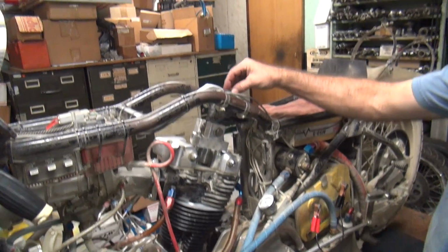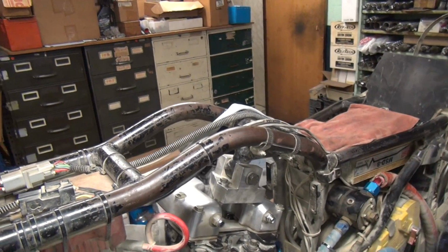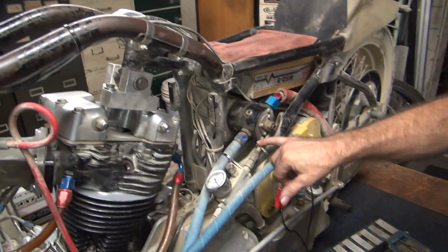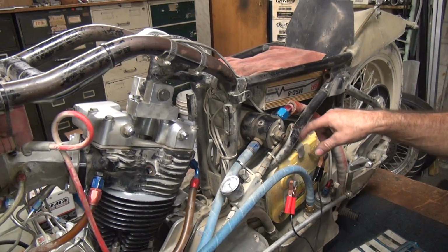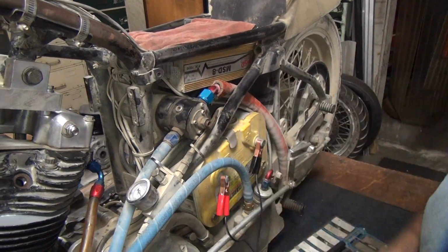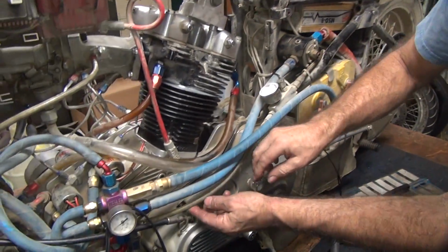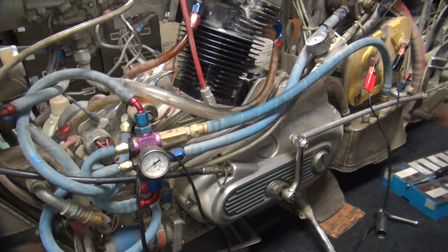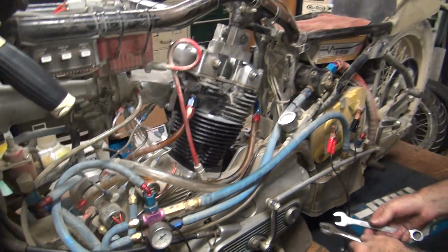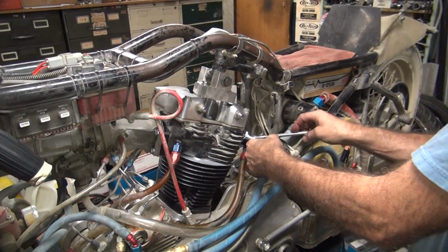See, this is stainless up here for my nitrous and brakes. But it's all coated. It's all clear coated. So here's the nitrous line. So it doesn't eat up everything. See, my frame's not eating up. My oil pumps or fuel pump's not eating up. If that was just raw stainless, the whole thing would be eaten up. See, this one goes along the top of the motor down here, and see, there's no damage anywhere. So if it's not coated, you have all kinds of damage.